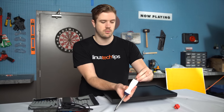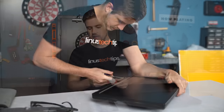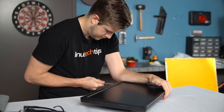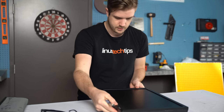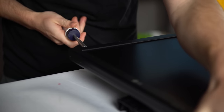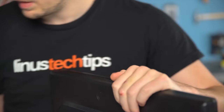Removing bezels on monitors kind of super sucks. I'm going to use just a flat head to pry it off — not super visually appealing. Realistically you're supposed to use a spudger, but I just bent the whole head off of one of mine. The problem with this monitor is it's metal and it doesn't give at all. It might be nicer if you have something plastic. So I'm going to start on the bottom — that way it's hopefully going to be the least viewed part of the monitor.